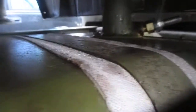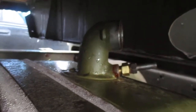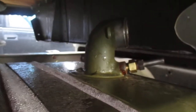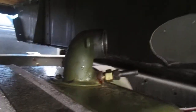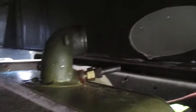Okay, that's tight enough. I don't want to go too tight because I don't want to crack the cast steel fitting. This brass fitting will fit to a point and then it won't compress anymore and it'll crack the fitting. So that's tight enough.